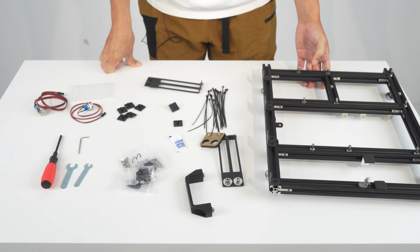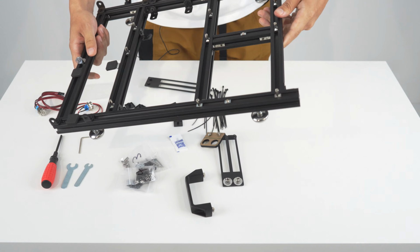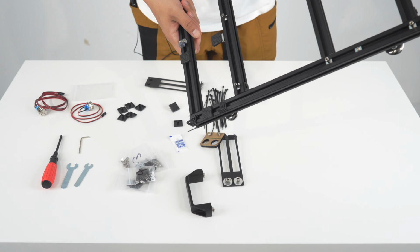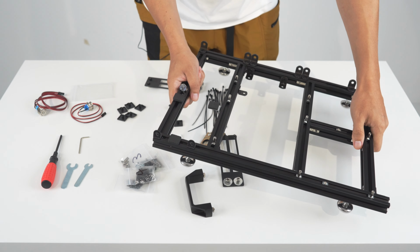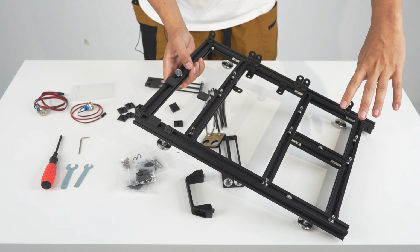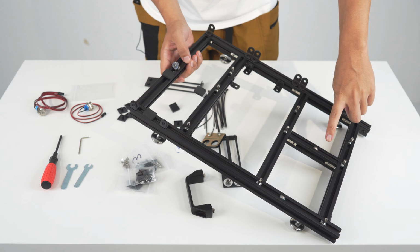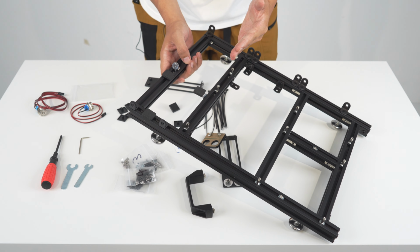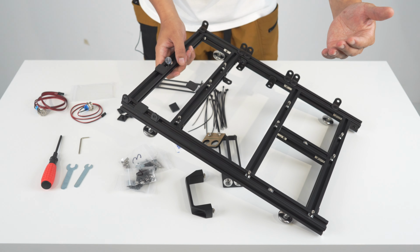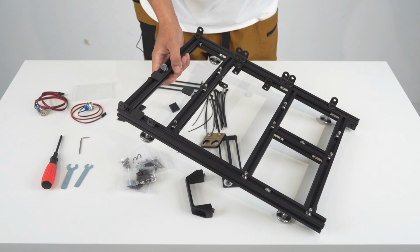And that's about it. And then the layout of this, so this can actually fit up to an ATX. And the way it works is you have the ATX mounted here, and then you can have the power supply here, and then the graphic card will sit here, and then if you're running AIO, you can put it right here, and that's what we're going to be doing.